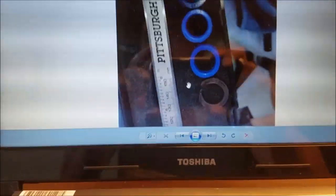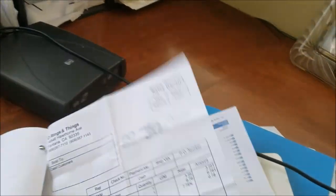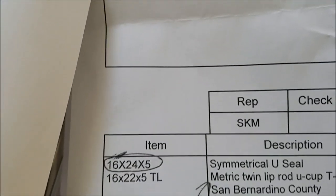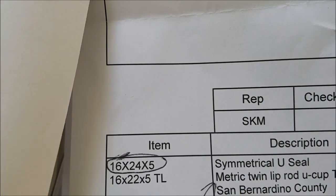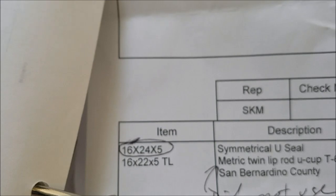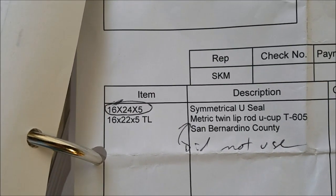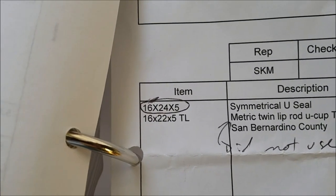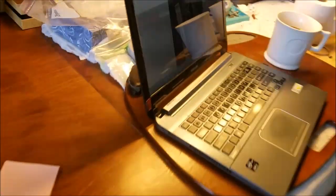The place where you would buy it — I already mentioned it at the beginning of the video — it's O-Ring and Things. The seal you want is the 16x24x5. The one below that is the one the shop recommended to match it up, but I didn't use that one. The bottom one shown is the original seal.